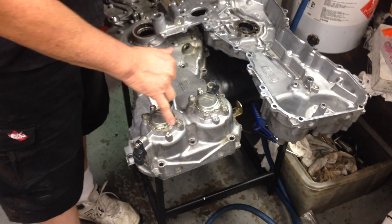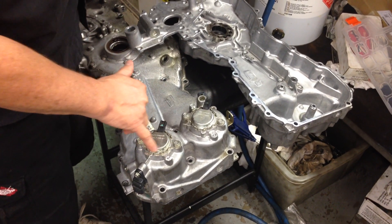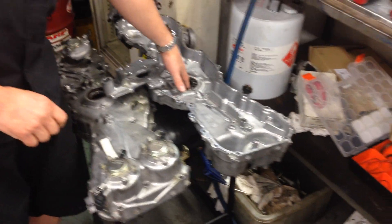What I wanted to touch on here is the importance of making sure if you're doing an engine rebuild — where you may have done a big end bearing on this particular engine — when you're rebuilding these engines it's important that you get all the junk and the minute metal particles left over from the damaged bearings out of the engine. It's one thing to drain the oil and put fresh oil in when you rebuild your engine, but it's another thing to make sure that there's no leftover parts in the ports of the oil galleries, in the heads, in the variable cam controllers, and also in the little simple things like on this engine — when we pulled the covers off, there were minute particles of metal in and around all of these sensors. This can get inside the oil pump drive assembly, which is a machined assembly, and if you don't repair, service, or replace it correctly, you won't have the correct oil pressure when the engine starts back up.